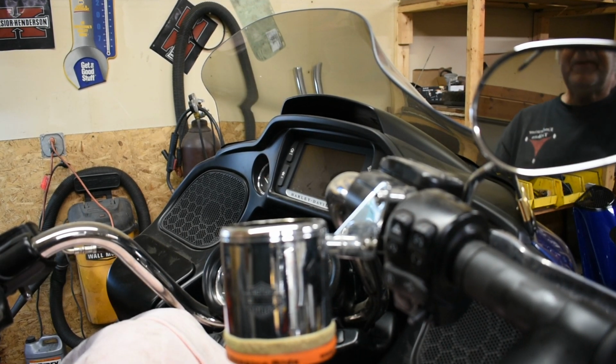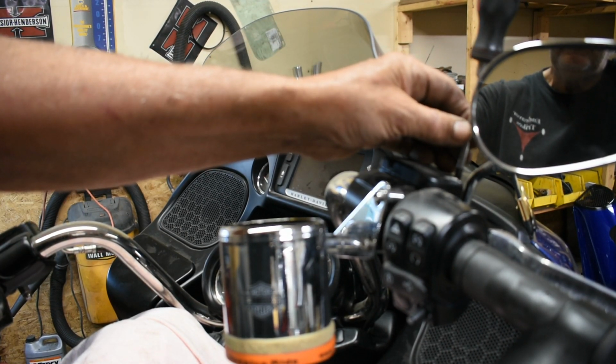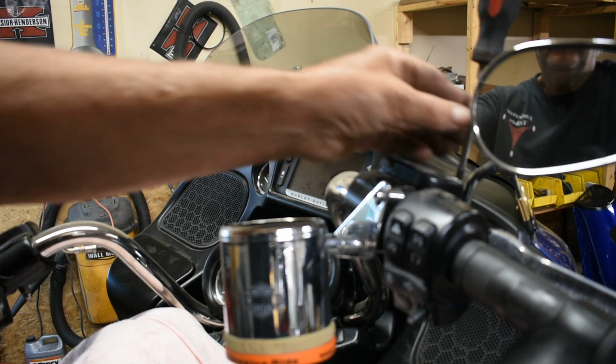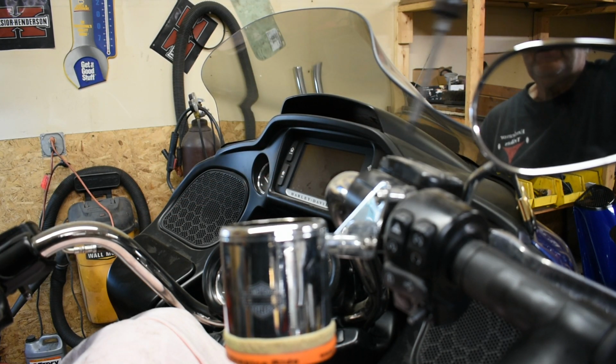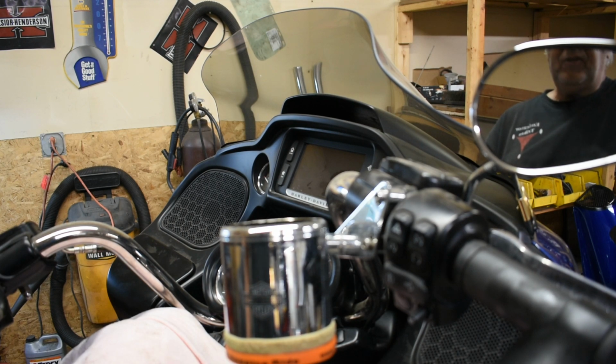Otherwise, it's pretty straightforward. So, one last thing I want to mention here is when I put the cap on and tighten these Phillips screws, and almost all brake reservoirs are set up this way, I just use 2 fingers on the screwdriver like this, and just basically tighten it with my thumb and my index finger, and that's it. That's all you need to do.